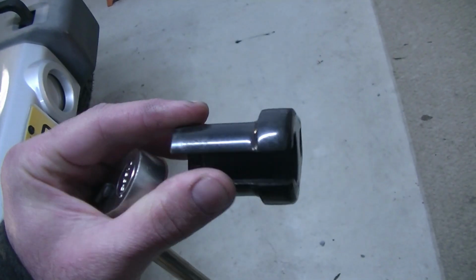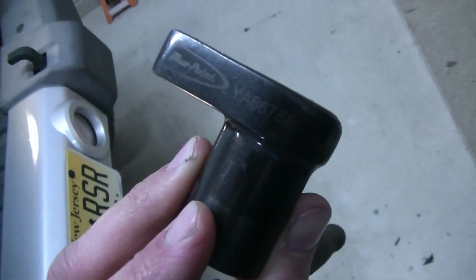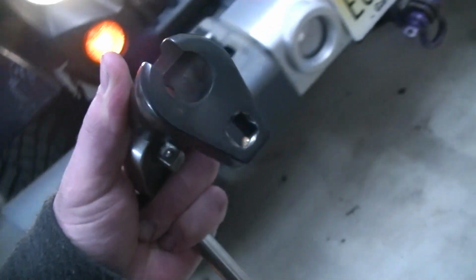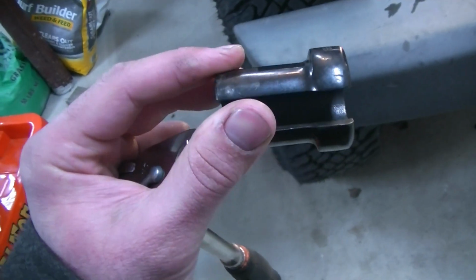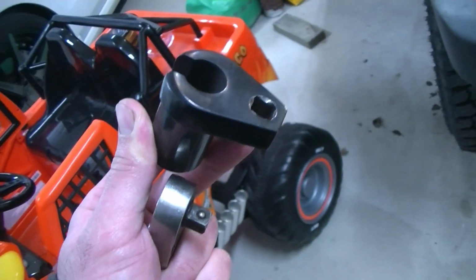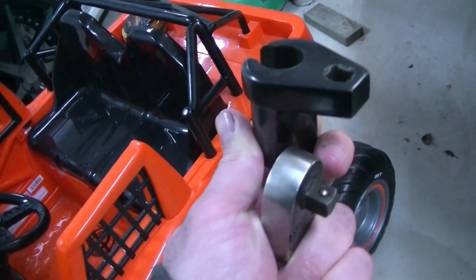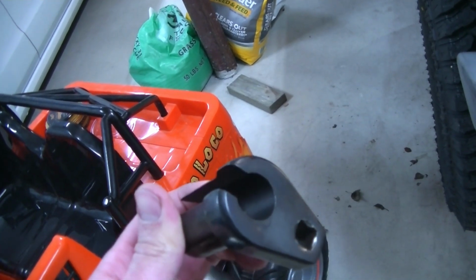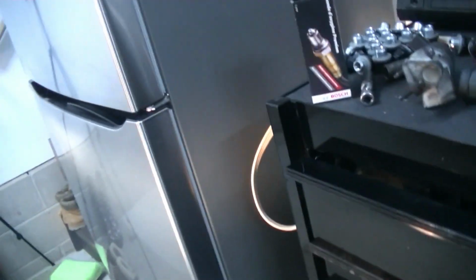Now the easiest way to get your old oxygen sensor out and your new one in is going to be with an oxygen sensor wrench like this. This is a Blue Point, model numbers right there. I'll link one of these down in the description below. This thing has more than paid for itself. Used this thing thousands of times at the dealership with all the engines that I've done. But basically this end here plugs into your ratchet and you put it over the sensor. You put the wires through here and then you go ahead and break it loose. So let's get under there, break this loose, and then we'll get our new one in.